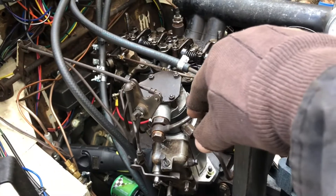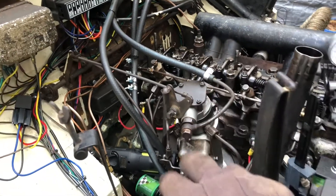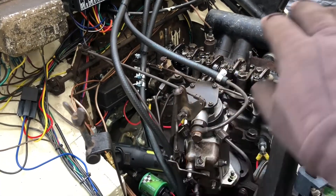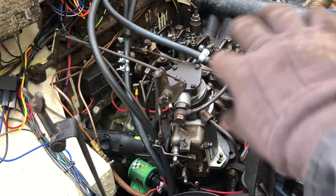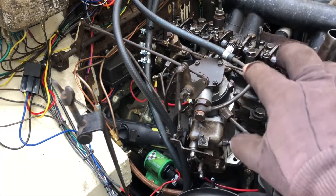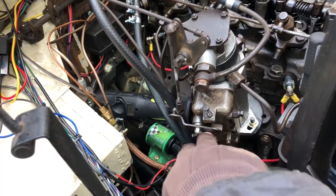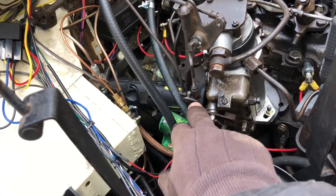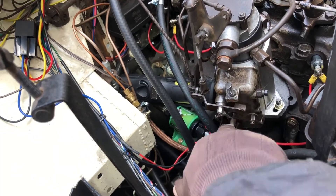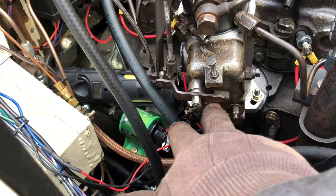The vehicle still has no power — it has enough to drive around but can't get up to speed, can't even get it out of second gear, which is still struggling. Thinking about the diesel pump: before, to keep it running I had to keep the idle up the whole way. I had to have the idle adjuster — which is down here — almost all the way in.